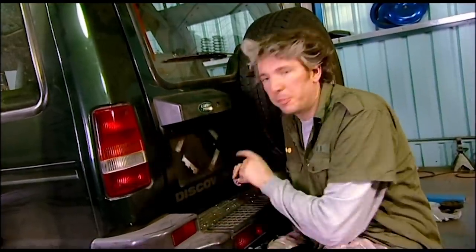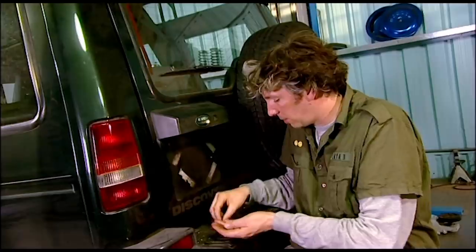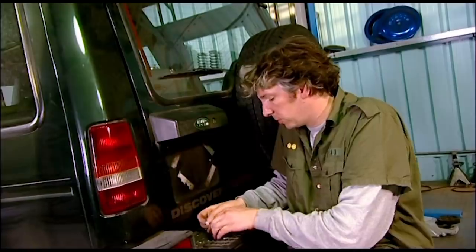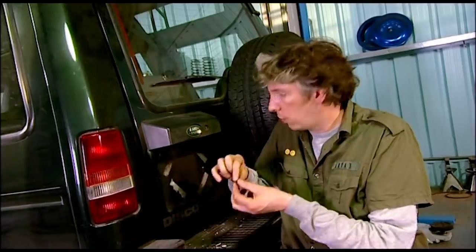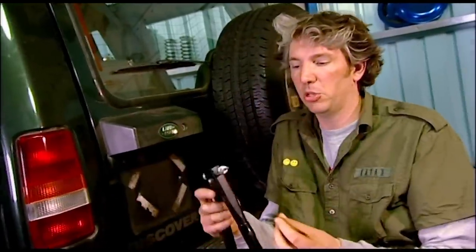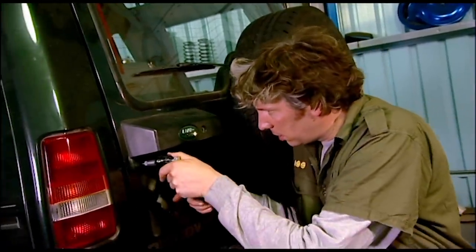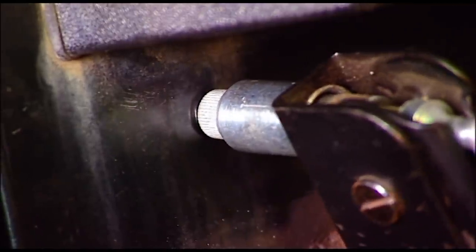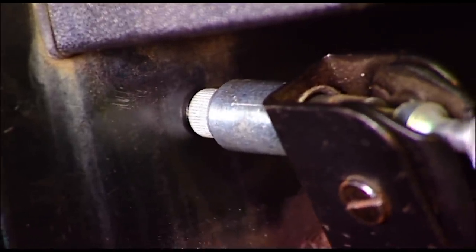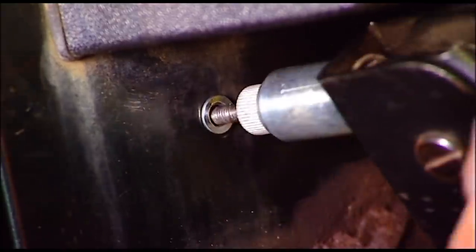The ladder is going to be bolted into position but I can't just put any old bolts in here because I can't get the nuts on the back. So very cleverly, in the kit that comes with the ladder, I've got these little things called rivnuts. As the name suggests they're a rivet and a nut all in one. I put it onto this special machine which is a bit like a normal pop rivet gun, pop it into the hole and clamp it up. That crushes the nut either side of the metal and ends up with a captive nut which the bolt can then tighten up to, holding everything in position. Very clever little thing.